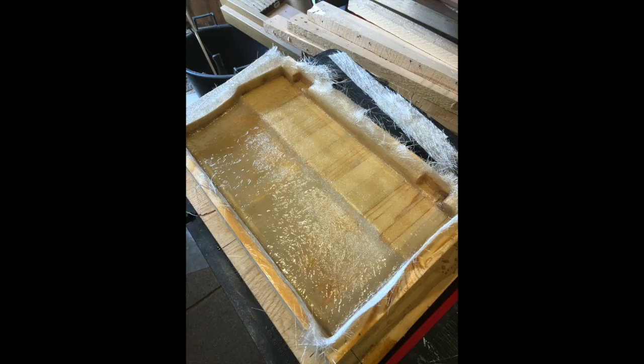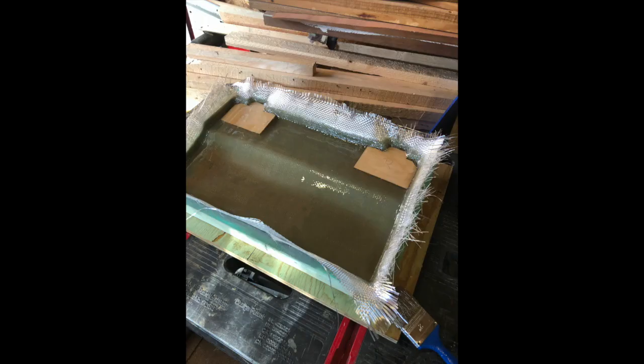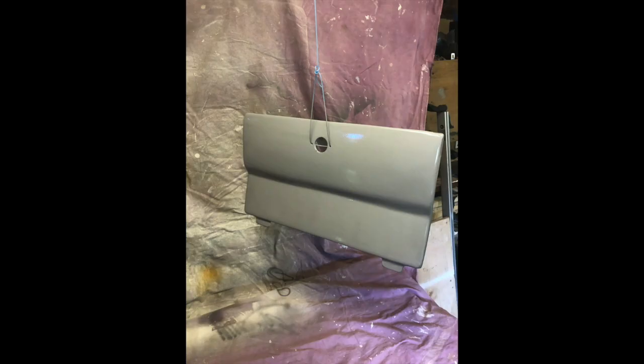I'm lucky enough to have a brother who's quite good at this type of thing, though he happens to live on the other side of the world, but there are plenty of videos on YouTube showing you how to do it. Once the mould is made you line it with a releasing agent, which enables you to get the cover out when you've done it. Then you paint the inside of the mould with the gel coat, add your fibreglass, then gel coat over the top, and when it's all dry, if you're lucky you can pop your part out of the mould. This requires a video all of its own but I didn't take any footage, so only pictures I'm afraid. Then you can either spray it or just polish it up and put it on — I made it the wrong colour so I had to spray it.